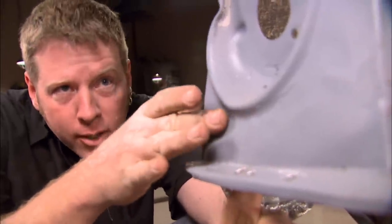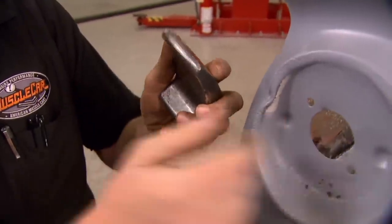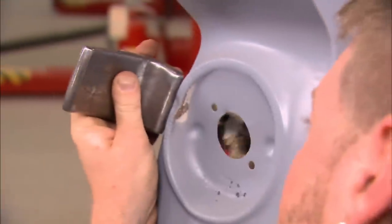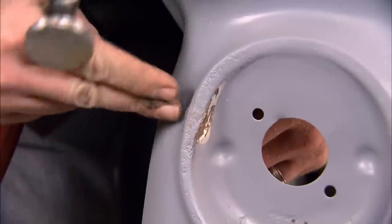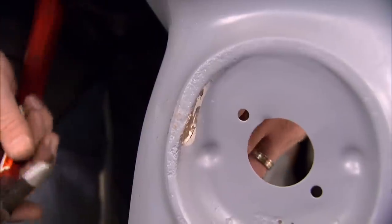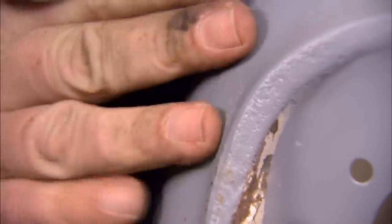I can see it's still pinched a little bit. I'm going to take one more whack because I can sight this one right down that other one. Since this is almost the same radius, I'm going to use this tip on the inside and whack the snot out of it to get the body line back. Right here we've got a high spot where it got hit and pushed the metal up. You've got to work that down — put the dolly on the back side to support the low area, hit the high spot, and as you move that down, that low spot will walk back up.